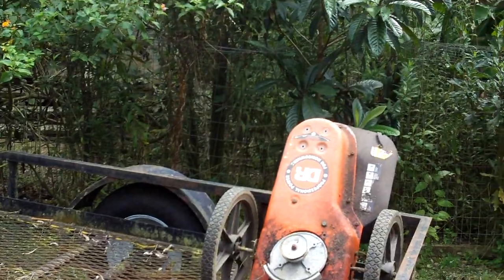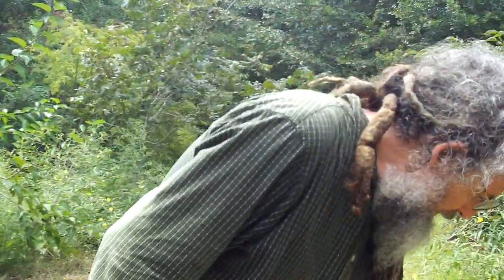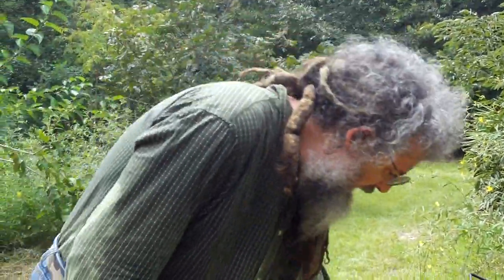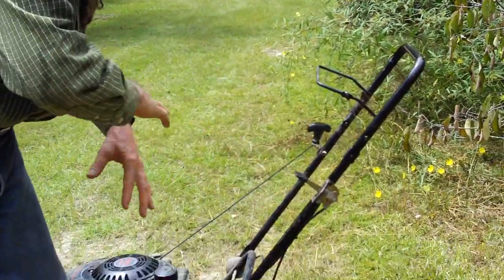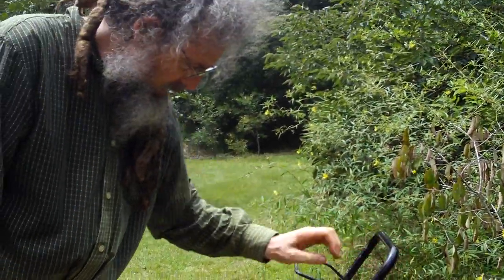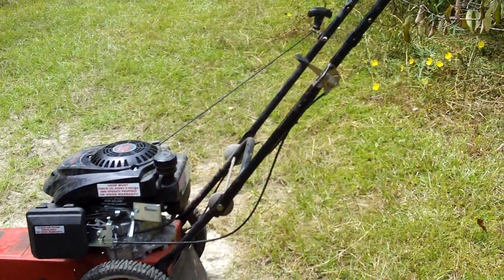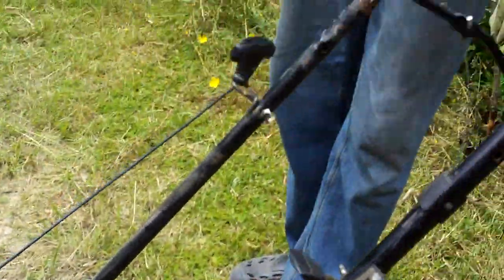and that's basically all it took, is rigging the throttle, and of course strapping the cables down in a way that, all of these things hinge right here, so you can put this in the trunk of a car, so you have to have your cables so that they'll flex around that. So I did, and I strapped them down with these wire ties, whatever ties you call them. And that was it. That's the whole installation. It didn't really take me very long at all.